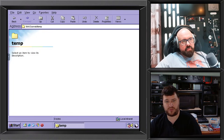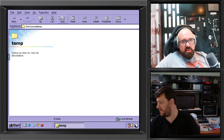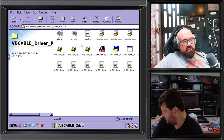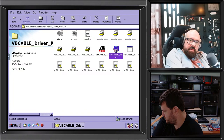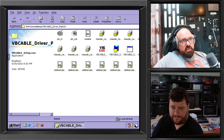I don't think Windows 95 had USB support at all, did it? With Windows 95, you can pass through a keyboard and mouse, but in a slightly different way: you emulate a serial keyboard and mouse. A very good question for all this, though: would that only work with PCI pass-through? What about AGP and ISA stuff? There's no AGP to PCIe adapter I've ever managed to find. I don't think anyone's ever made one, so unfortunately you're limited to PCIe devices. That's why I went for the PCI Voodoo 3000. But if there was an AGP adapter, that would be super cool.